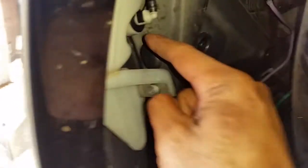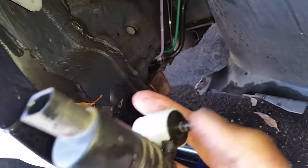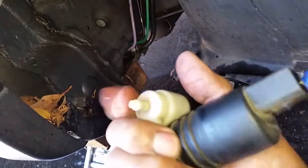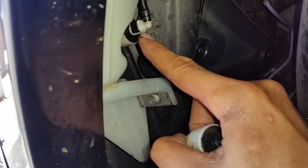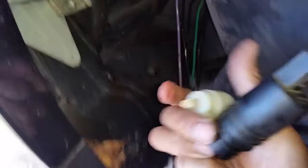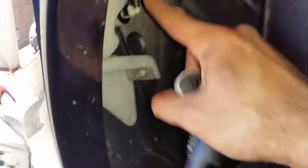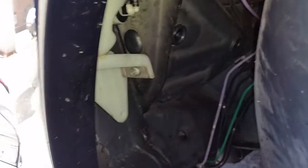You've got to make sure that the black part of the pump — see how it's black here and then white on the other side — the black clip goes onto the black connector, and the white clip on the back matches the white side. Otherwise if you put it in the wrong way, the pump will work but no fluid will be squirting out.